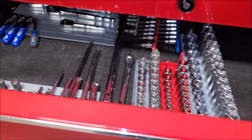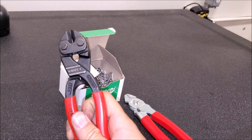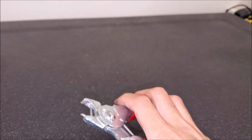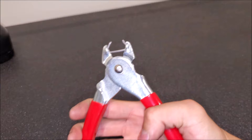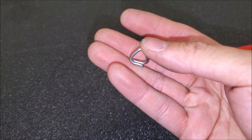A lot of the tools you'll see today are pretty common from a normal toolbox. However, you will need some specialty tools — hog ring pliers and mini bolt cutters. You could use other types of cutters, but the mini bolt cutters are way more efficient and do a much better job of cutting out the hog rings. Here's how the hog ring pliers work: it holds the ring in place in a pocket, so you only have to focus on putting it onto the rail and compress it. This will now hold onto our upholstery and our seat.